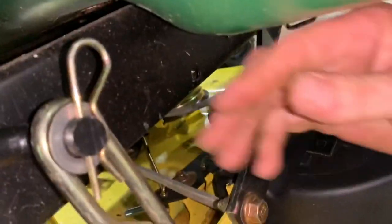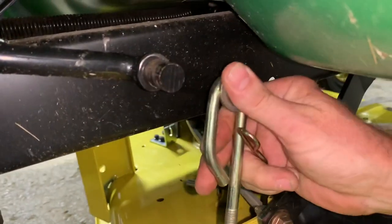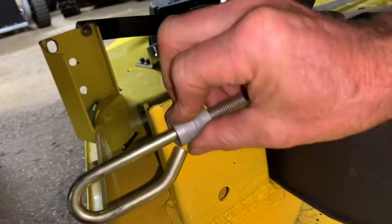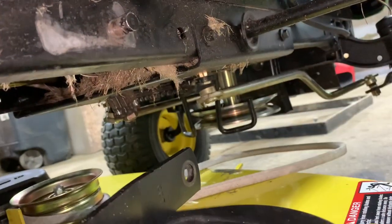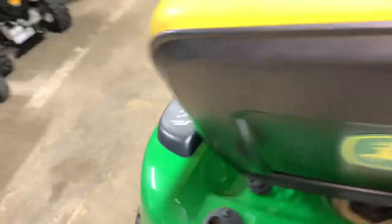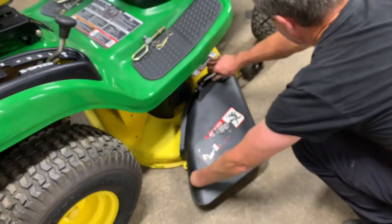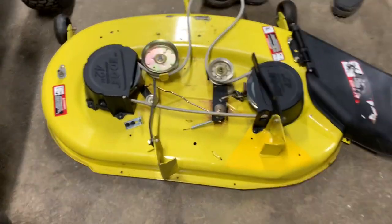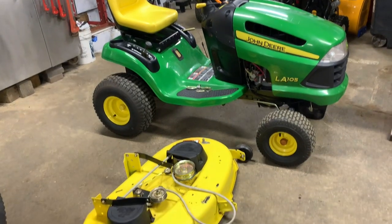Going to do the same thing on the other side. Start with the big clevis pin in the back — sometimes turning it sideways and then pushing it up will help it come out easier. Lifting up the mower deck, pop this off with the washer. Turn this thing 90, should pop right out. Take that pin out, pop that bar down. At this point I'm going to put the mower deck handle up — it takes the bars out of the way. Then I normally pull the mower deck out from the chute side and just slide it down. And that's pretty much how you remove the 42-inch edge mower deck on an LA-105. If you liked this video please give it a thumbs up, subscribe, share with your friends, and I do appreciate everybody watching.